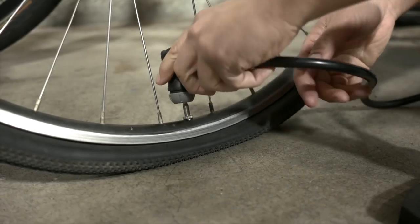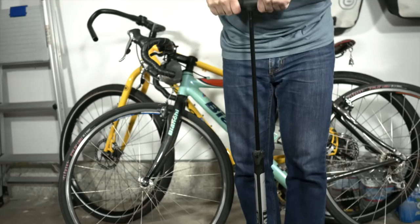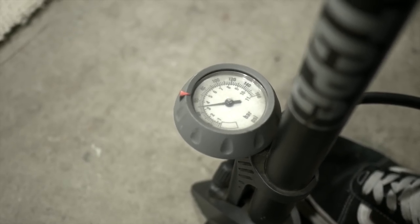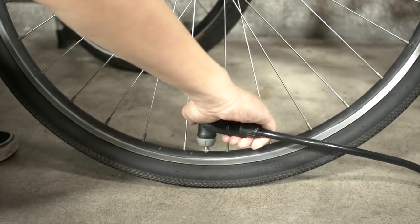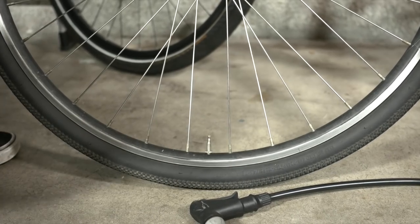Put the nozzle of the pump on the valve, flip the lock on the pump, and begin your compressions. Be sure to go all the way up and all the way down for the most efficient usage. Your pressure gauge should give you a PSI reading. Pump up to the desired pressure for your bike. I usually pump up to 10 PSI lower than the maximum recommended for a good balance of comfort as well as rolling resistance. Once you are satisfied with the air pressure, flip the lever back down and remove from the valve. If you have a Presta valve, screw the core back down.